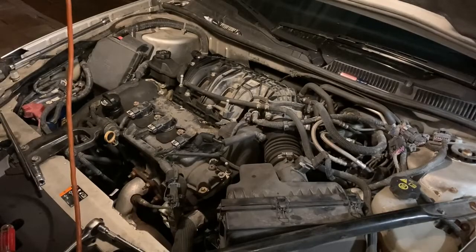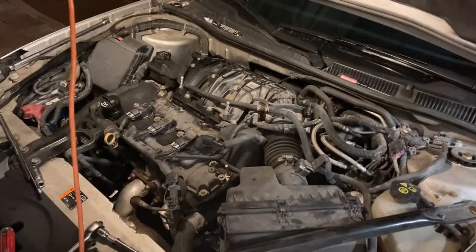All right, it's time to fire it up and make sure she still runs — hopefully even a little smoother. Runs great! Thanks for tuning in. We got the spark plugs changed on the 2012 Impala. On a scale of one to ten I'd rate this about a five, just because the rears were pretty hard to get to, but very doable with the proper tools. Make sure you have a universal joint for those tight spots on the back three cylinders. Overall not too bad — runs like a dream. If this video helped you, like and subscribe, drop your comments, and until next time, get out and do it yourself!